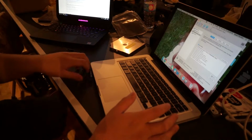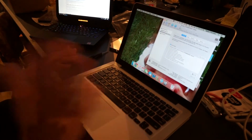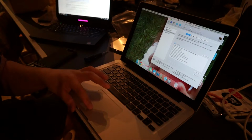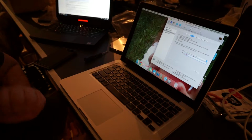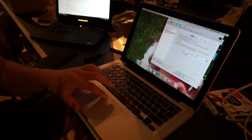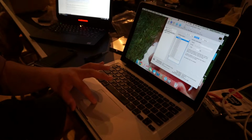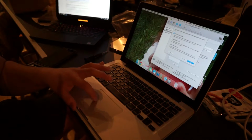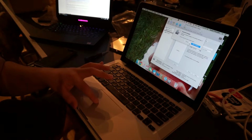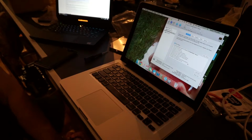Okay, so one of the important parts to do is to format the drive and make sure it's usable as a boot drive. So, I'm not sure if you can see this here, but it will be in one of the links in the description below. You have to partition it. So first erase it and make sure it's in Mac OS Extended journaled format. So Mac OS Extended and then in brackets journaled. You'll erase it, and once that's done, you can go to partition, click it, go to partition layout, go to one partition, options, and then set up as a GUID partition table. Apply that. Once you've done that, you can go to first aid and you can verify the disk. And once that's verified, you're good to go.